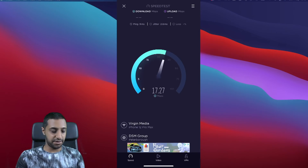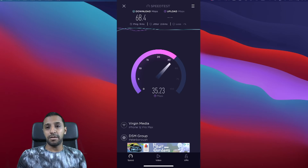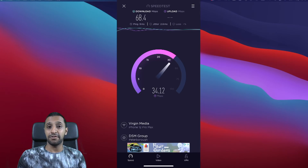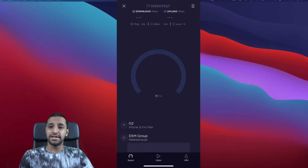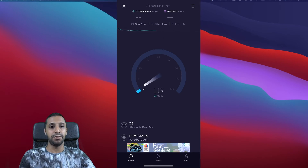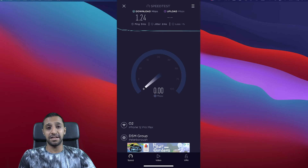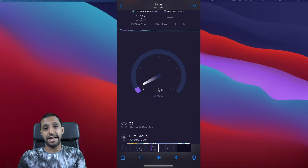Now for the furthest point — this is a screen recording, not done live. The router is on the first floor, I'm on the ground floor, approximately 20 to 25 meters away through brick walls and stud walls, and I'm getting about 68 Mbps down. On the other side of the house there are steel beams which skewed the results — connectivity was dropping between 4G and Wi-Fi. As expected, steel interference significantly impacts the signal. Now I'm going to plug in the mesh access point downstairs and re-run these tests.